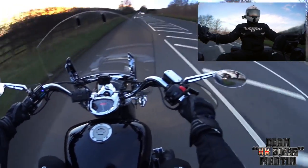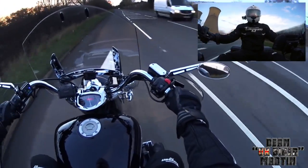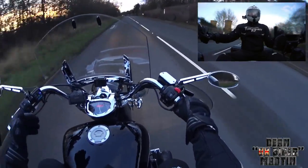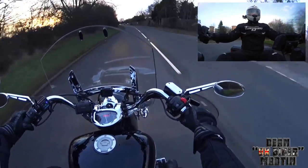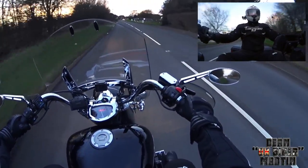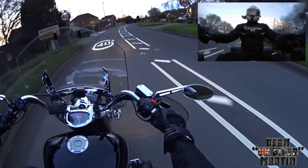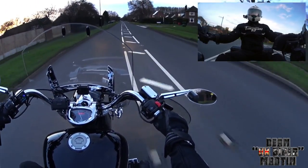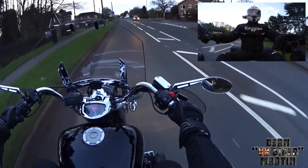I think I also need to get my clutch sorted — I've just had to pull over to adjust it. No matter how much I adjust the clutch lever, even to the point where I have the correct amount of free play, it still seems to slip a little bit when I'm going at higher revs. So I think it needs adjusting in the clutch housing rather than up here. I may have to adjust it a little bit more on the A38.